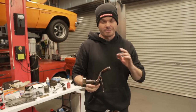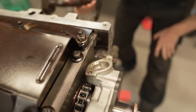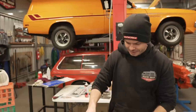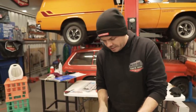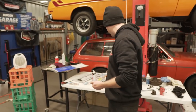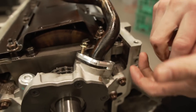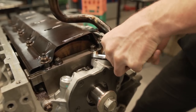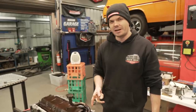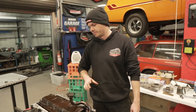So now we're going to put the pickup tube on, and this is probably one of the things we learned from the comments the most. You'll find interesting the way Holden did this - notice here two bolt holes with threads, but there's only one hole on the other side. Apparently what happens is they can sort of leak from there because they don't bolt up very tight. There is a solution - Warspeed has produced a kit, and this is the kit we learned about through your comments. It goes over the oil pickup like this, and then you need two bolts. That's designed to pull and clamp down the oil pickup tube to stop oil starvation. Pretty inexpensive - cheap insurance I would say.